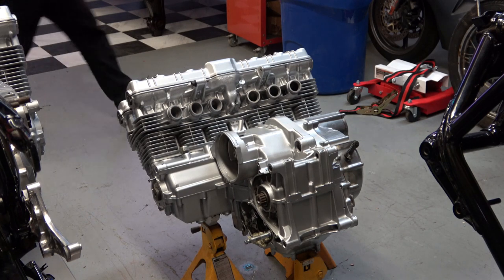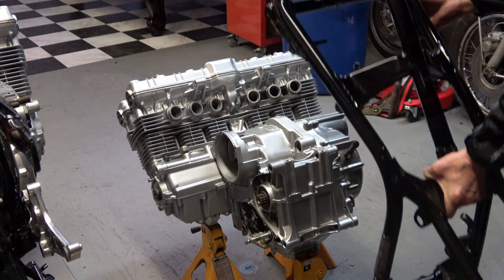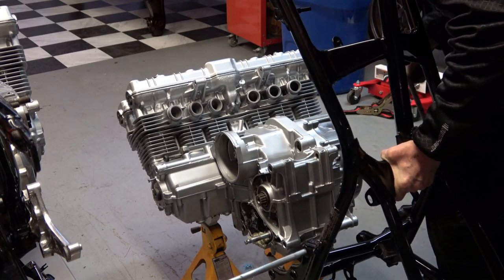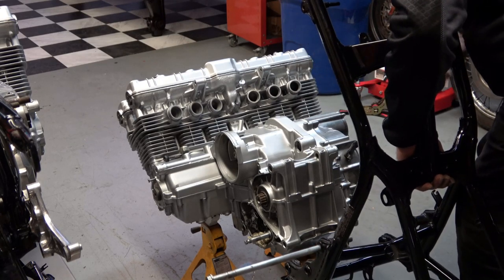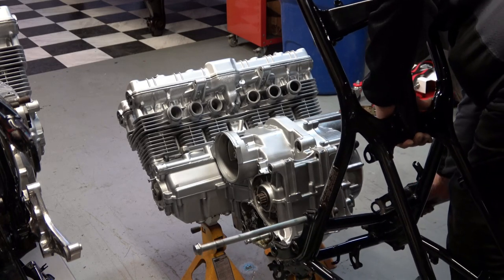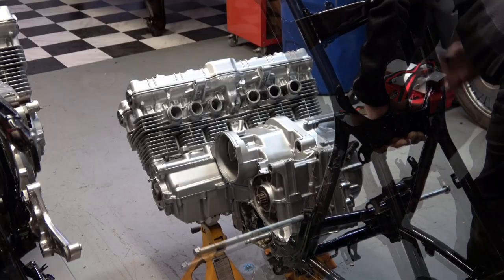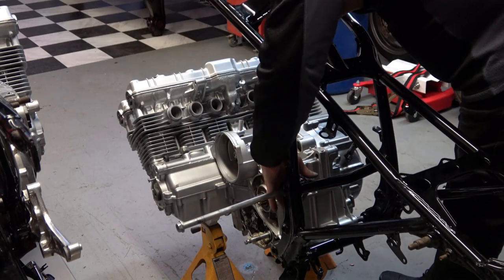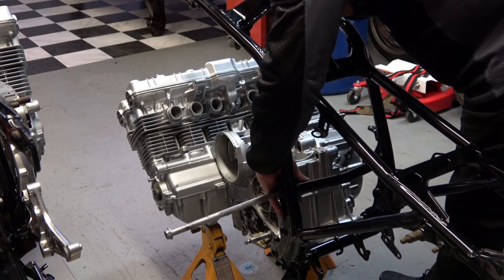The engine is ready to go and you just kind of lift up the frame. You'll notice in my right hand I've got the lower motor mount bolt — it's a little cumbersome at first because the frame is heavy enough to be a little awkward. I've got that bottom bolt in and just kind of stick it in a bit, then hinge the frame down and work the upper rear motor mount bolt with the spacer.